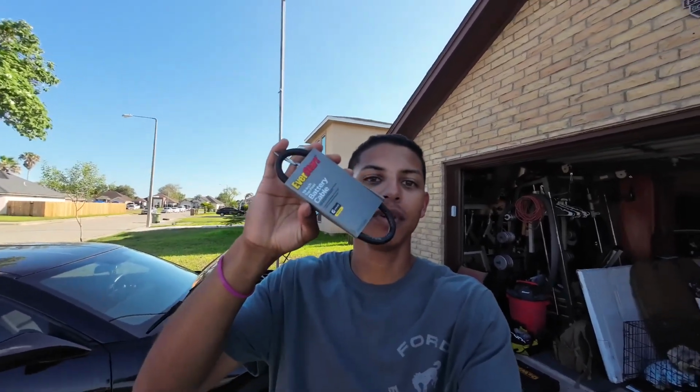And the reason I know that that ground wire only kind of helped is because a couple nights ago, I went to go get my girlfriend at McDonald's. I turned the car off. I went inside, got the food, came back to the car, tried to turn it back on. It wouldn't start, and I was stranded. So as I was there contemplating my life decisions in the McDonald's parking lot, I remembered that I bought a couple of these and I had left them in the trunk. So I added another ground wire here up by the engine head, which I'll show you guys right now.